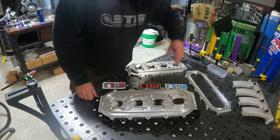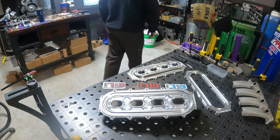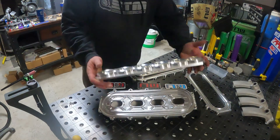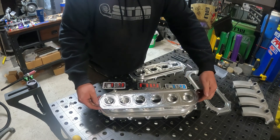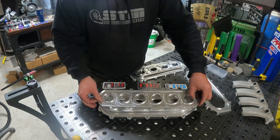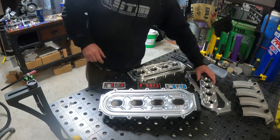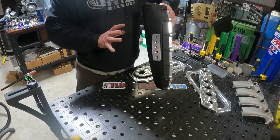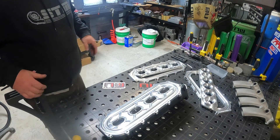With the kit, you can have the throttle body clamp and whatever else, but we'll customize and do whatever we need to do. Next goal: take the 24-valve VR6 flanges and get a VR6 option in there. I think I can make it fit — if not, we're going to figure something out, but we will get these things fitted in and you will have a plenum option for your VR6. Skunk also has a stackable flange to increase the volume you're going to need for the 2.8 and 3.2 liter engines.